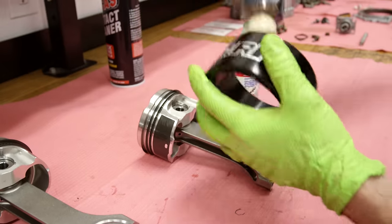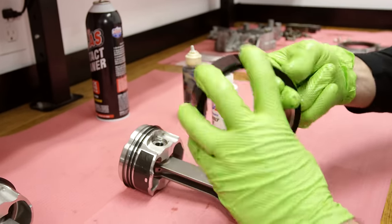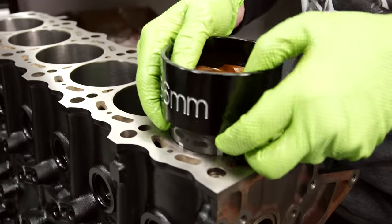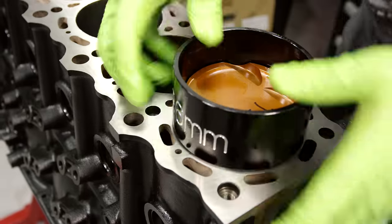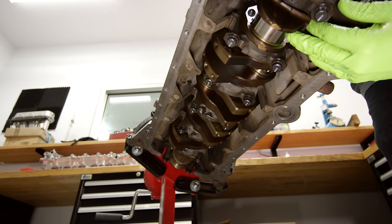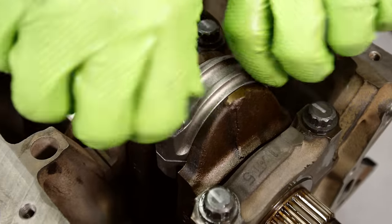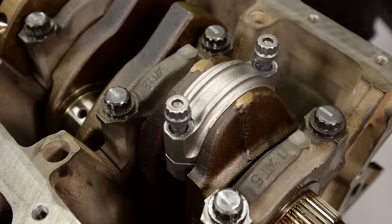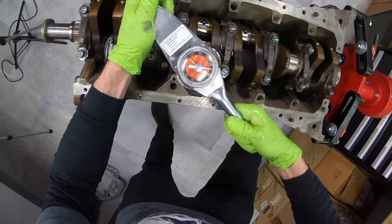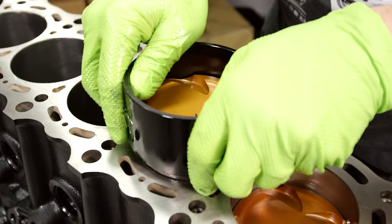This is the piston installation tool, and I'm also gonna lubricate that as well because the rings have to slide down it. I'll double check the ring alignment again, and now we're ready to put it in. The crankshaft is at bottom dead center, which means the crankshaft pin or journal is all the way at the bottom — that gives you the most room to make sure you don't push the rod into the main journal. These rods are from BC — their standard H-beam rod — which is gonna work great for our application, and they had them in stock, which is great because of the short timeframe of this build.